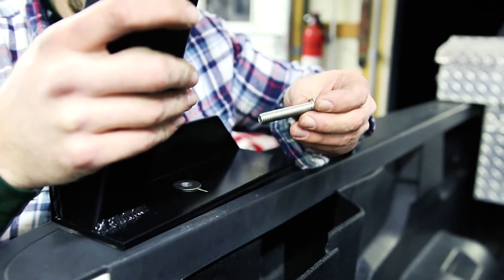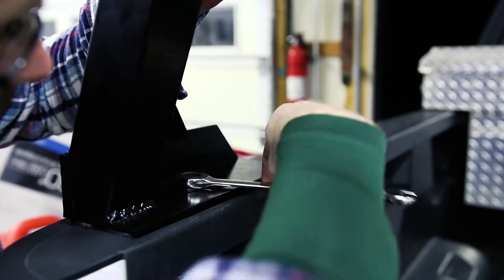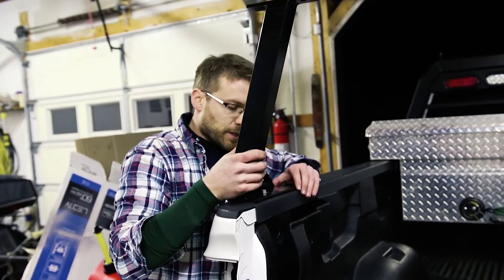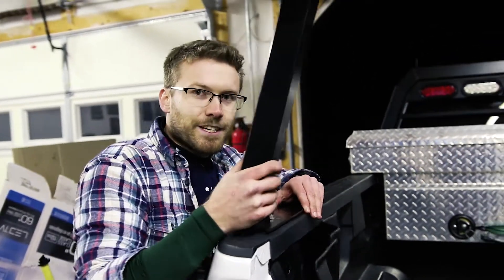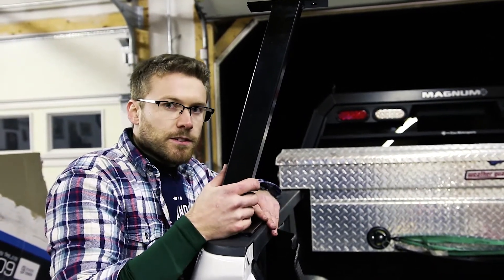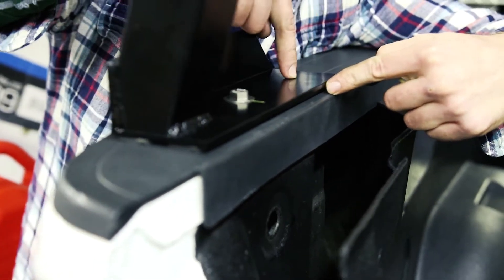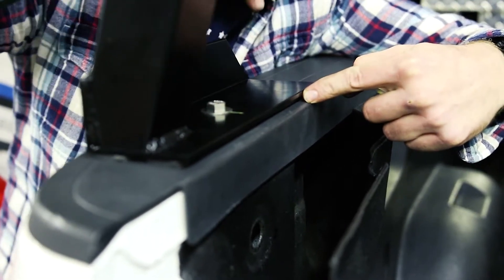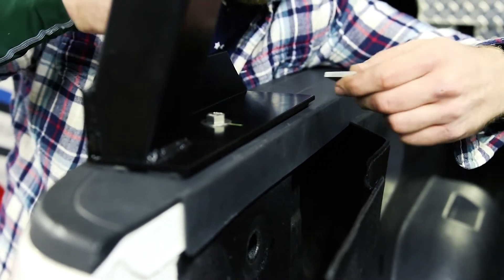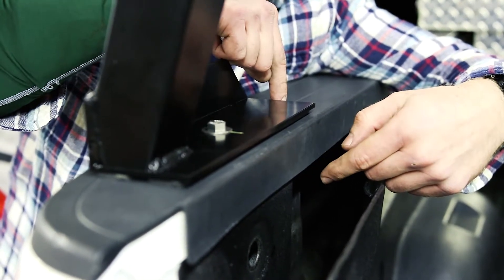We've got our washer and we're going to take the other bolt that came with the post kit and mount that right up in there. That's the first bolt installed. You do have the option of leaving it with just this one bolt, but it can shimmy a little bit and I don't like that. So I'm going to put a second bolt right back here to make sure this is installed safely and securely. For the location of this second bolt, we're going to put it an inch and a half in so it lines up with the first bolt — the depth in this direction will vary based on your truck bed. Make sure you're going to have access to tighten the bolt from the bottom of the rail.